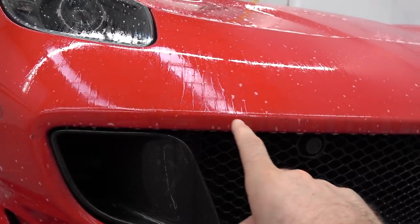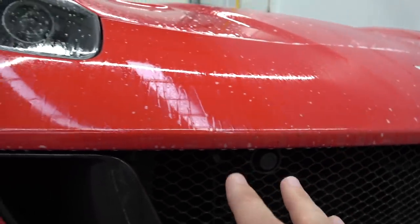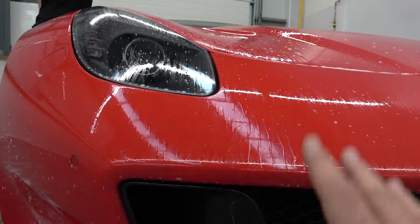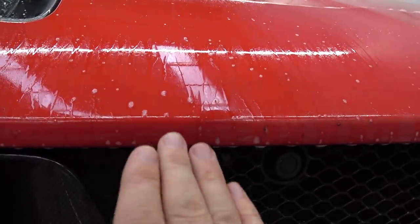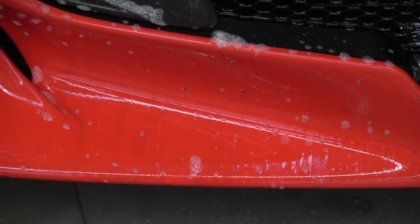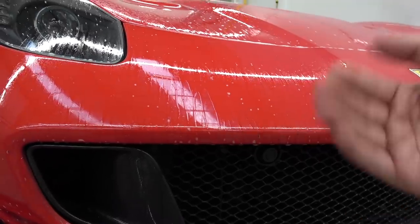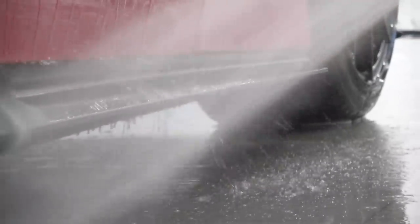Here's an example of the reason we're using the degreaser on the car before we jet wash it. Up close you can see all of these contaminants — grit and general road grime. The idea is before we jet wash, we don't want to dilute this product too much so it can do its job and lift this off. When this comes off easier with the jet wash, you'll find yourself naturally not wanting to put the lance too close to the bodywork to try and shift it. Citrus application done — lifting off the surface grime.